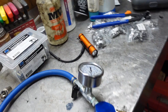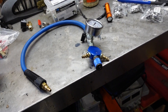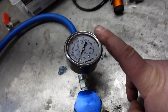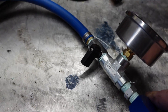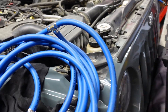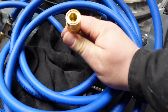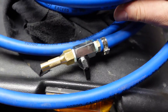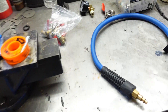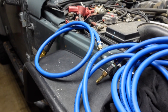I skipped all the B-roll to come to the end product. I rearranged it so everything can be taken apart and I don't have to worry about it being tangled. The tires will connect to these two, the secondary air fill connects to this. I went to a liquid gauge, put that little small valve in compared to the old setup. Coming over to the hose itself I put all the bands on - that cleans it up really nice. Quick connect right there - we are looking way cleaner. That looks way nicer than those other small brass valves, so let's take the Jeep outside and hook this up.